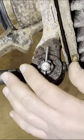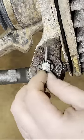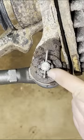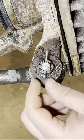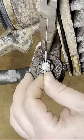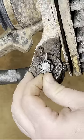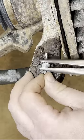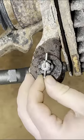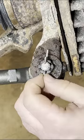If you ever have to take this tie rod off to service another part of the vehicle, that becomes a real problem. What I do instead is leave the tail end of the cotter pin sticking out — usually about a quarter of an inch — and then bend just the tip like that.